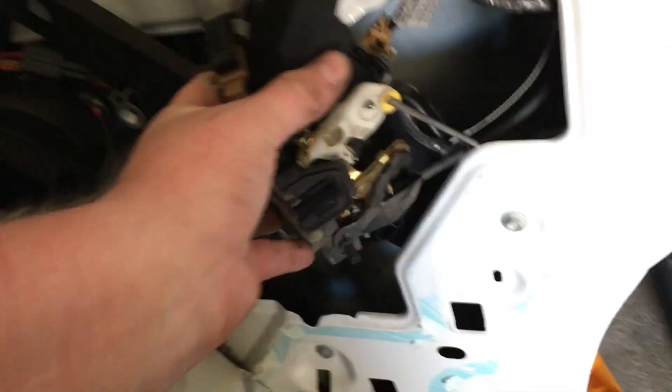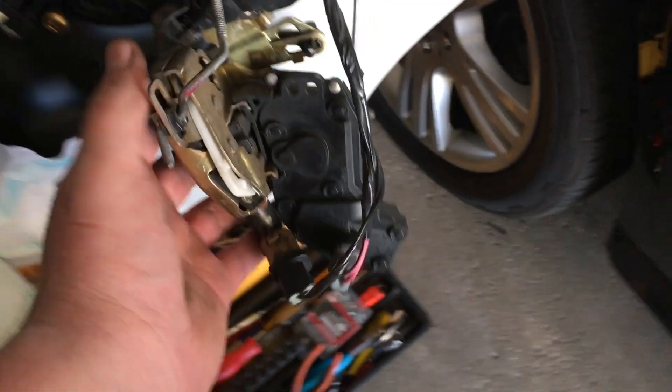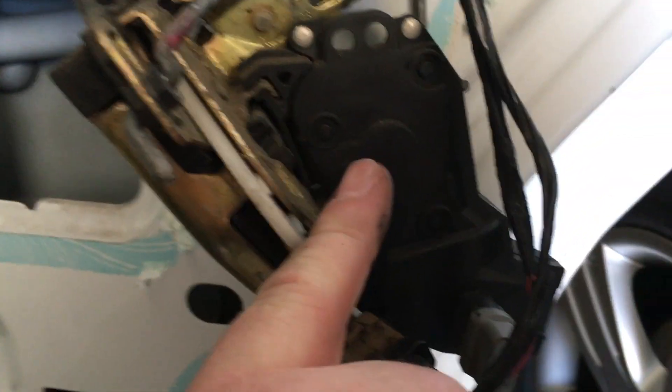You may notice — see that green and black clip right there? If you undo that green clip and slide it to the right, it allows the rod for the handle to release, and you can work it out so this piece comes free. I also unscrewed the top piece as well. After some jiggling, this piece comes free and here's our door lock actuator, which we are replacing with this new one.